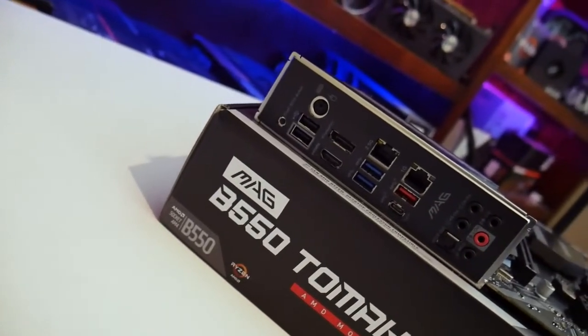Your display ports, the caveat here is going to be that if you want to run any display off of the motherboard itself, you'll have to have a supporting CPU that has integrated graphics. So you're talking about like the 2200G, 2400G, 3200G, and 3400G. If you have one of those, this motherboard will support that, and you can just go ahead and get it hooked up and it'll function. It has 1 HDMI slot on the motherboard and 1 DisplayPort slot on the motherboard. So that also supports HDMI 2.0, and you're going to be able to support FreeSync off of that if you're running the AMD integrated GPUs. So good to note as far as all that goes.